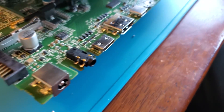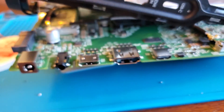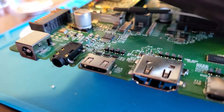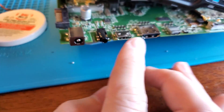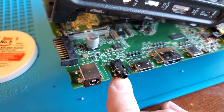Make sure that the connector is nice and snug on there and not going anywhere, and that each one of those four joints is properly soldered. We got it nice and secure — a lot more secure than it was earlier.